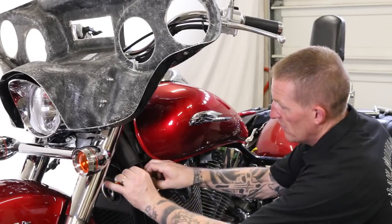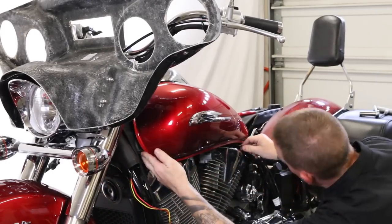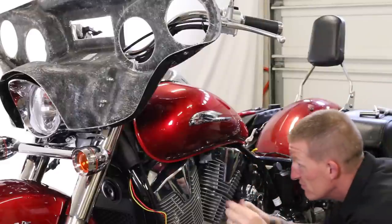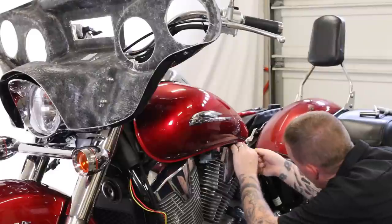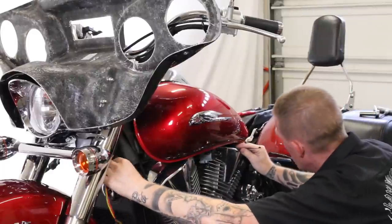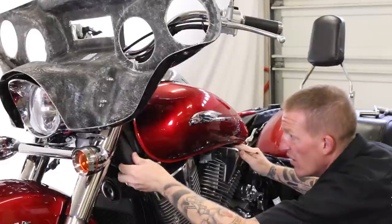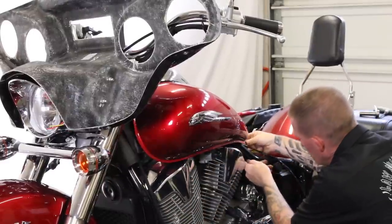Now, as you can see, they've got all three of those wires taped together and made their custom wire loom. Ryan is guiding the wire up underneath the tank and off of the engine. He's going to run one end into the battery compartment so we can hook the positive, negative, and remote up. The other end will fish up along the frame and up into the fairing. You can run it any way you want — just hide it and keep it up off the motor so that it doesn't melt.